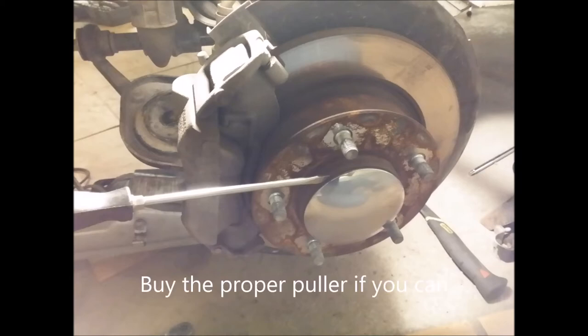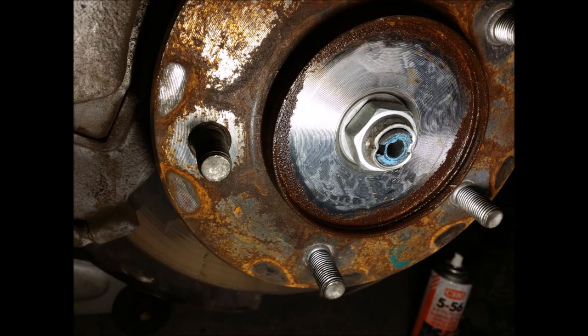In the service guide, the order of axle removal is listed at a later stage — after you've already jacked the vehicle and removed things like the ball joints. If you don't have an impact wrench you're going to be completely out of luck. What I would do if doing this again is loosen the axle nuts while the vehicle is still on the ground with a breaker bar — that way you won't need an impact wrench to remove the front axle.